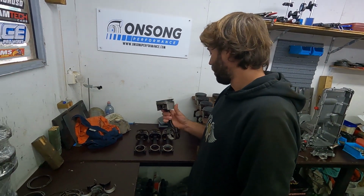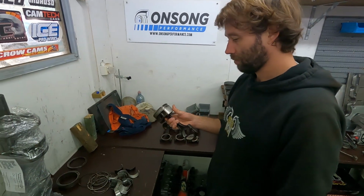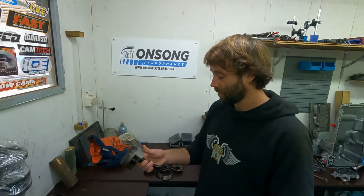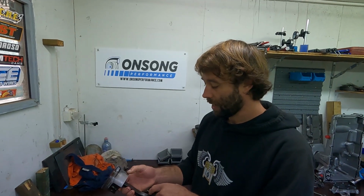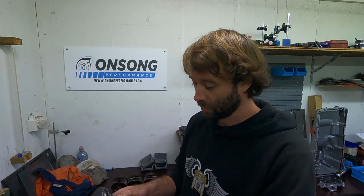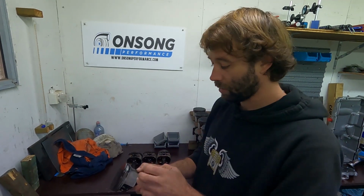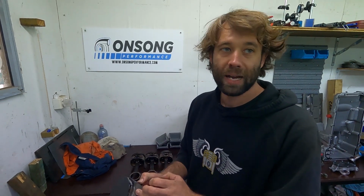But anyway, my conclusion is that, as I knew when I was tuning this, it was just generating knock when it shouldn't have been. With this bent rod, that's obviously going to shorten the deck height, which has opened up our quench area. I don't think any of the others were particularly knocking. I reckon it kept picking up this particular cylinder that was getting bad knock because of the reduced quench height.